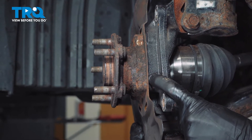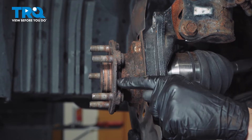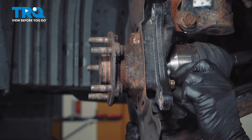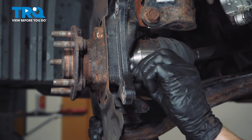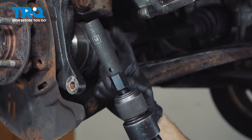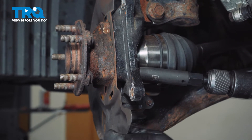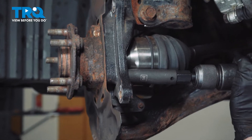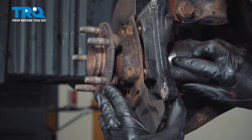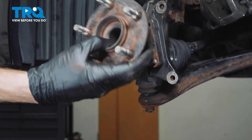Now we can start separating the wheel bearing from the steering knuckle. Since we're replacing the bearing anyway, you could give it a couple of loving bonks with a hammer to try to break it free, but be extremely careful because you could cause damage to the axle itself. The best way, if you have access to the tool, is to take one of your bolts and slide it right back inside this area — put it in at least five or six good threads. The tool you'll want is an air hammer with a half-inch drive bit. Place your half-inch drive impact socket directly on the head of the bolt and start separating the bearing. Once separated, we can separate the backing plate from the wheel bearing as well.